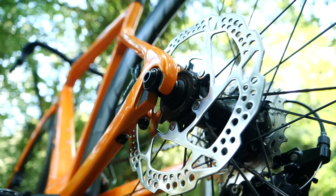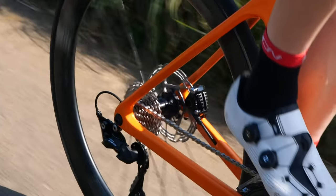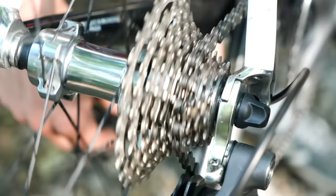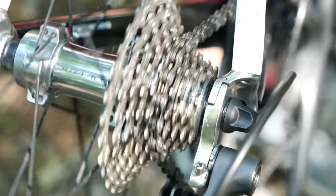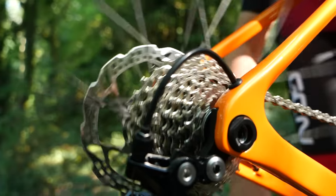The other crucial difference here is that modern 105 has hydraulic disc brakes. Much more on that later. This groupset is 10-speed, and the modern Shimano 105 R7000 that I'm going to compare it against is 11-speed.